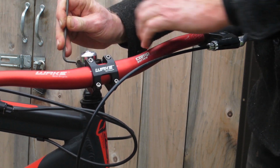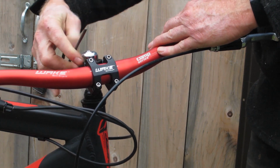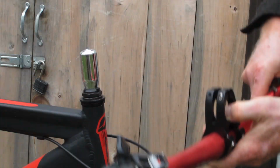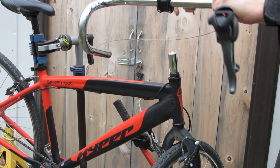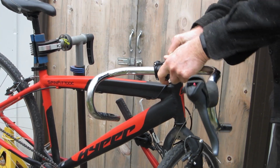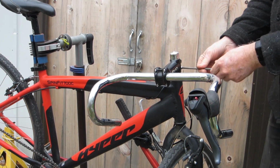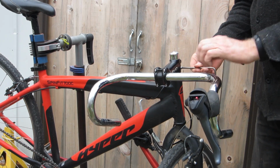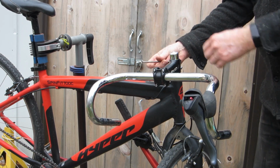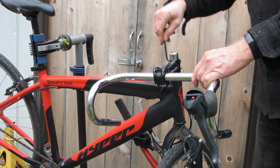The first step was to remove the existing handlebar and stem and replace it with another. What I used was a leftover Evo stem and a set of drop bars from some old 10-speed that I bought years ago for parts. To satisfy my own curiosity, I took an old Leers combination shifter that I had kicking around and I tried that on. Well, as it turns out, that combo shifter doesn't have a long enough pull to activate the linear pull brakes on the bike.